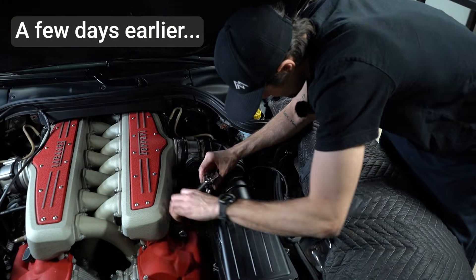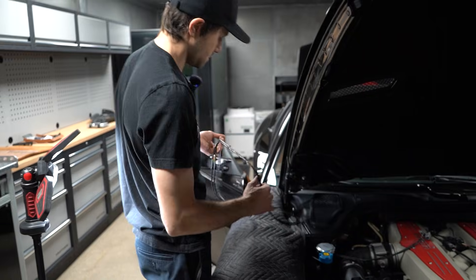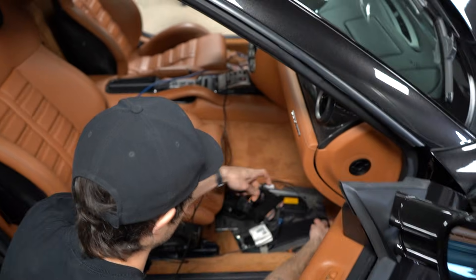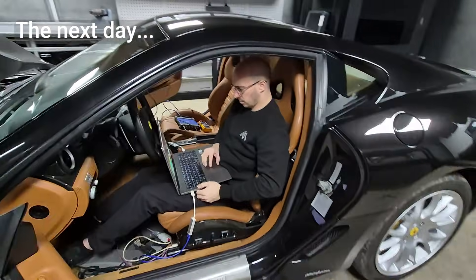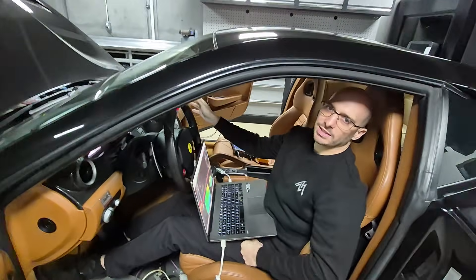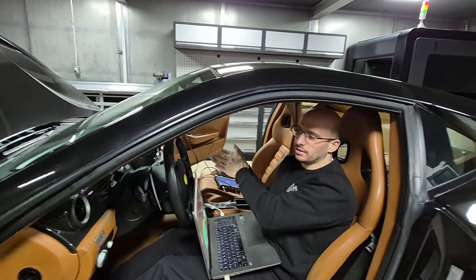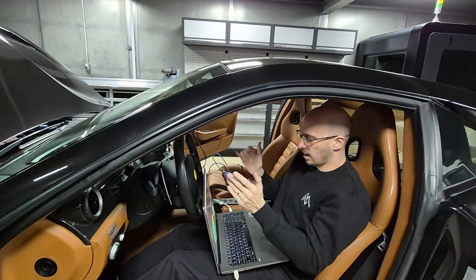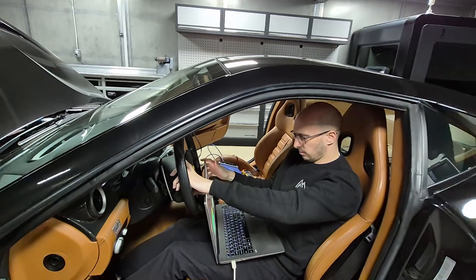Is this thing about to run on 12 cylinders, all powered by MoTeC? We're going to try — two ECUs. We've had it running on the right side. These are basically two inline-six engines sharing a crank, so we call the right one our 2JZ and the left one our RB30. We've got the right 2JZ working and we're going to try now. Timing is good, everything seems ready — there's timing on the right side, that's running fine, and we've checked the left.